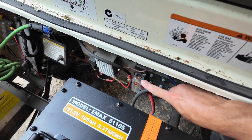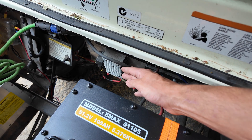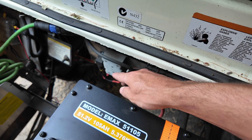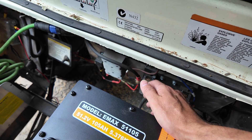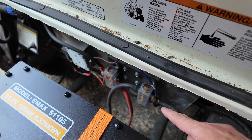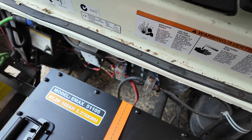Down here in the back I already have a DC to DC converter. There are just four wires that come out — you put two wires on the 48-volt side, and then the two output wires go on the 12-volt side. So if you have any lights, cigarette socket, USB, whatever, I have mine running over to a distribution panel. I've also moved my positive and negative connections here. In a regular cart, the positive goes to your DC controller box and the negative goes to the motor — so all you need to do is connect positive and negative. It couldn't be any more simple.